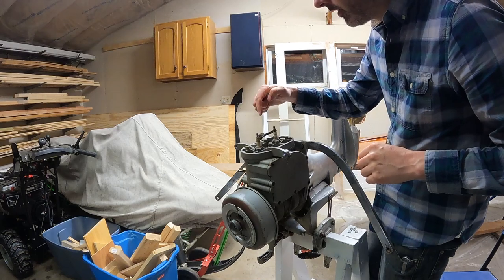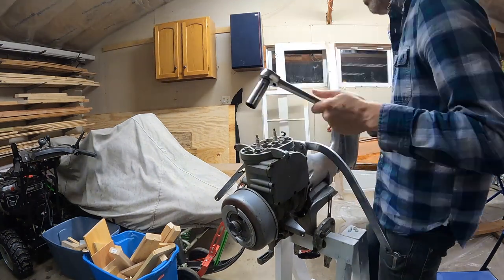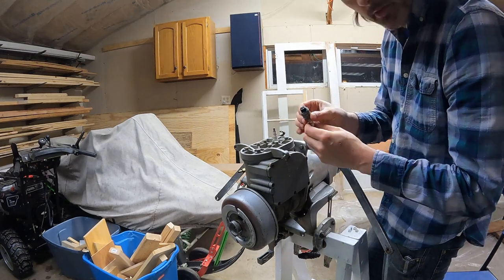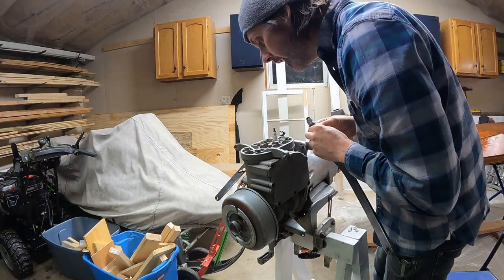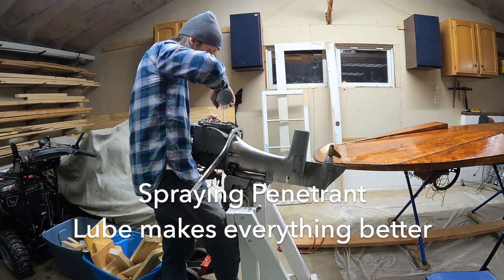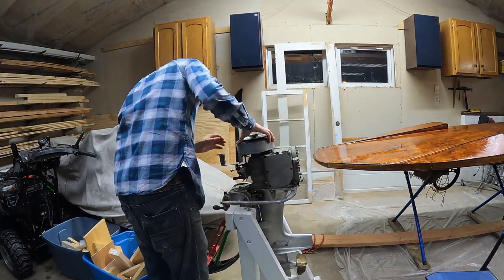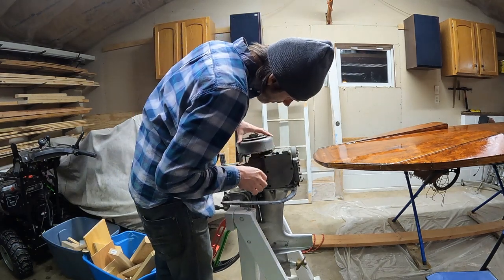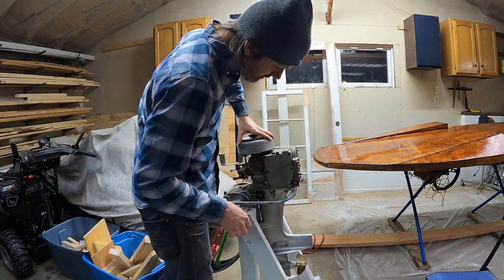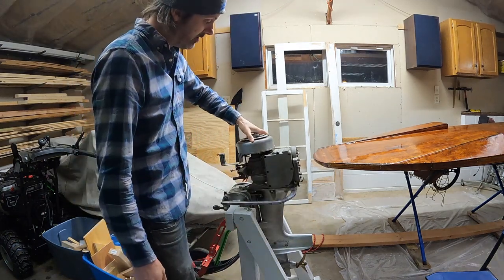So it looks like the spark plug wire with more gold paint is on top. Now hopefully these spark plugs don't show any signs of corrosion, and they don't. They look pretty oily, so that's good. Oh, this is working fine. Look at that. Okay, cool. So the motor isn't seized. Something's wrong with that recoil.